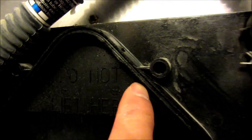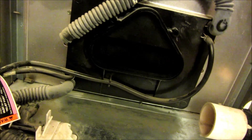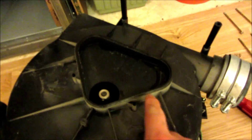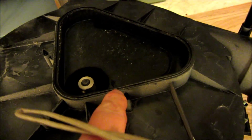There is a triangular mounting point, and they say you should put silicone on it. Make sure you buy silicone rated at 400 degrees Fahrenheit, even though it doesn't really get that hot — maybe 80 degrees Fahrenheit. I struggled with this because I wanted to do a test run to confirm the mounting points were flush. There are 2 points that help you align, but they didn't really help much because you can't see or feel whether it was aligned.